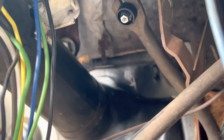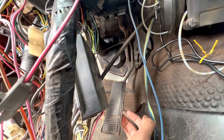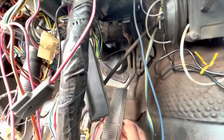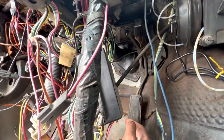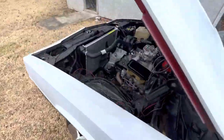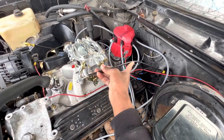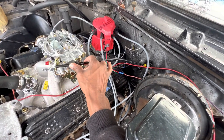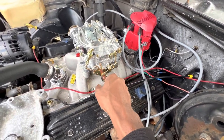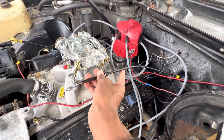Just that fast, the joint is in. Normally your throttle is going to be up like this, but since I don't have my throttle bracket on right now - normally that little joint will be up against the firewall, then you hit the gas, it goes to the floor, comes out, which pulls that wire out, and then when you go out here to the carb - my throttle bracket when it comes in is going to sit on these two studs and then hook this joint up right here. I don't think it's supposed to have this much bend in it. Hopefully it won't be a big deal, but I'll get that bracket. You use your return spring so it gets that ricochet action how you need it. This cable might be too long - I probably have to go back to O'Reilly's, but we'll see once I get that throttle bracket on.